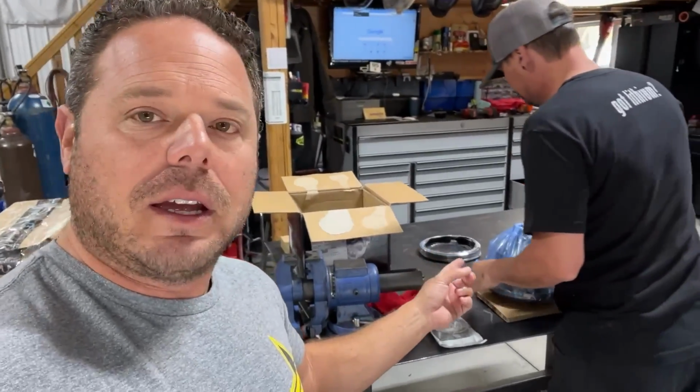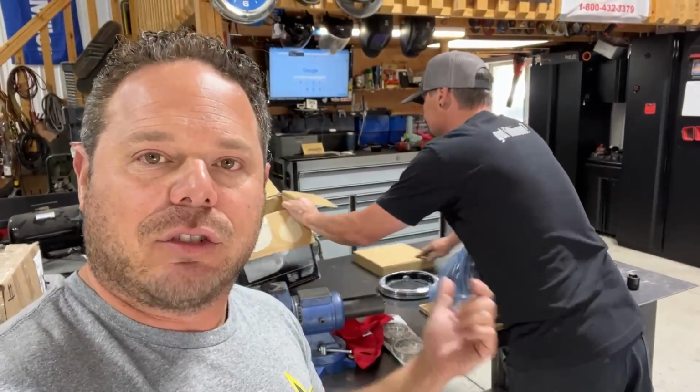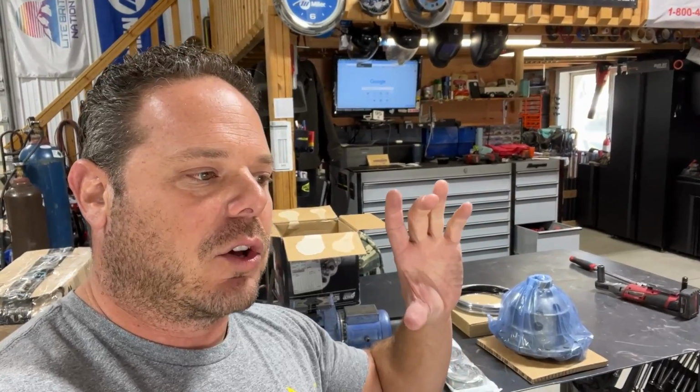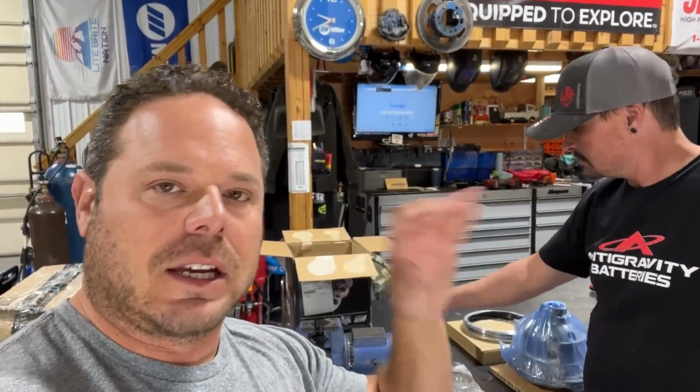We've used ARB air in the rear, and we have had issues. At the very beginning, when we first put the Dynatracs in years ago, the little slide collar inside that the air goes into leaked. I hear a lot of people's leak on trail, and sometimes it's install error, sometimes it's manufacturer, and it's kind of annoying to hear your pump constantly kick on and kick off.